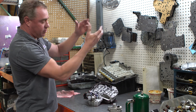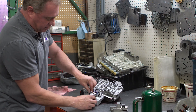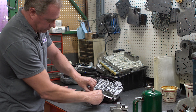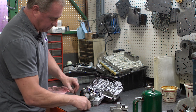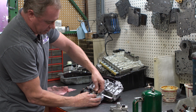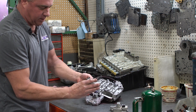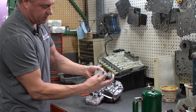This is upside down of course. You drop your transmission pan, and this piece here — you're going to take out your four bolts, these four bolts on your governor solenoid. Then you're going to unclip this little connector and unclip this guy, and then this entire block comes off, and we're going to replace it with this.